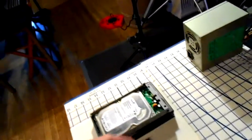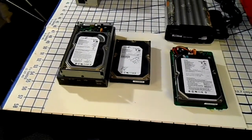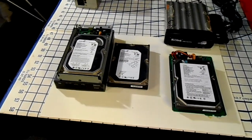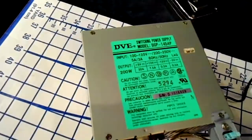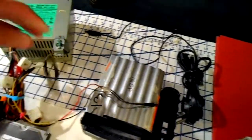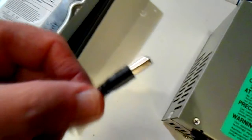I'm gonna go with the bigger SATA — I have an extra SATA here which is a 200 gig, so I've got a 250 and a 200. Now the power adapter for this setup we lost or can't locate, so what we've decided to do — and it works really well — is we've converted an old ATX power supply out of a computer to a 12 volt line that we use to power these drives. This is the old school type power supply; we've mounted a switch to the side here. We've come into the 12 volt line, which is the black and the yellow, we've cut one of these ends off and I've connected it, soldered it directly to a jack that's able to plug right into the drive.